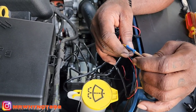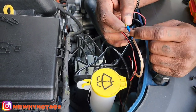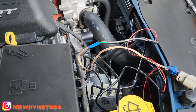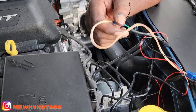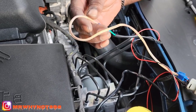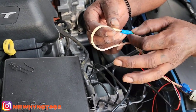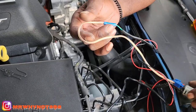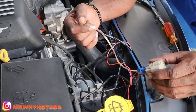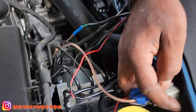So what I did — I cut the ends off the green and yellow wires so I had a little wire sticking out, and I got another piece of wire and connected it to them. I put a little cap on to cover and secure it so I didn't have to use electric tape. It's connected up under here, nice and snug and tight.